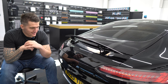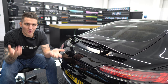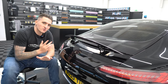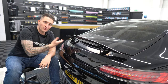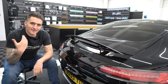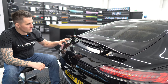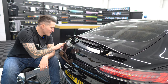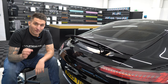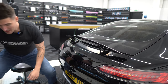The technique we've used for many years: we took one of our plush towels, chopped it into small one-by-one-inch squares, saturated them in tar and glue remover, and literally just pressed them onto the residue. The weight of the towel and the liquid itself stuck to the car. Instead of constantly spraying and wiping, you can leave it and do other things — we left it on for about 20 minutes, then just lifted the towel off and rolled it with our hands and it all peeled off. But there's still a remnant of the AMG lettering, and don't forget the paint underneath all the letters and emblems is perfect — it's never seen any weather, straight from the factory.